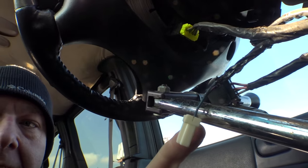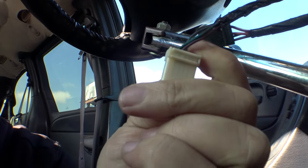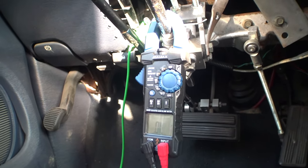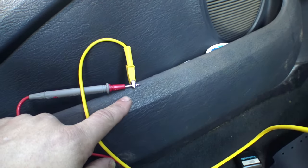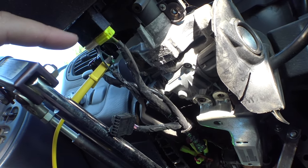There are a bunch of buttons up here for cruise control, but there are only two other wires, so I'm assuming those are some sort of multiplexed or voltage divider type thing. What I'm going to do is flay the insulation a little bit on this wire, connect up a jumper, hook up a meter, then honk the horn and see if it connects to ground. The way most of these work on vehicles is a single wire comes up through the steering wheel and shorts to the chassis metalwork in the steering column to activate the horn. There are some computers and relays involved here, but near as I can tell from the schematics I've found, it's still the same on this van. I've got the meter hanging here with a solid ground on one side, and the other side clamped onto that wire — I'm 99% sure that's the correct wire.